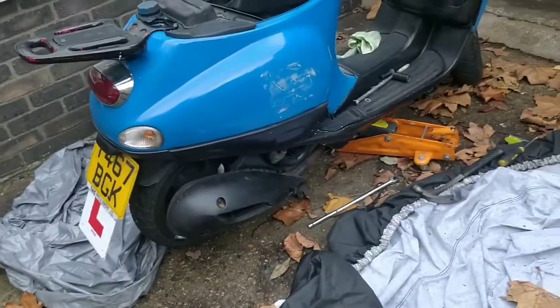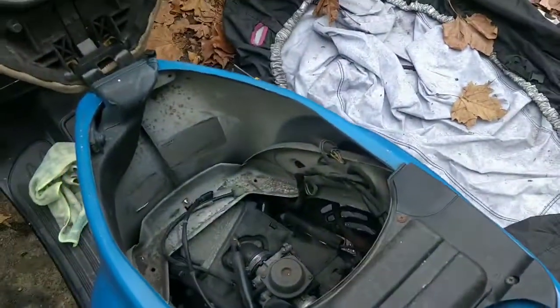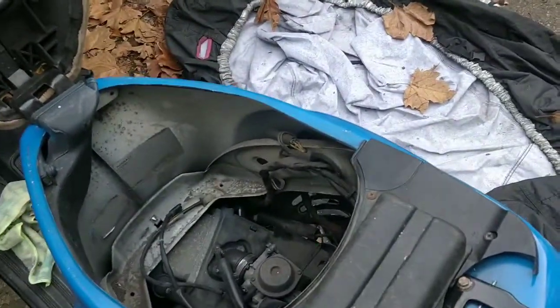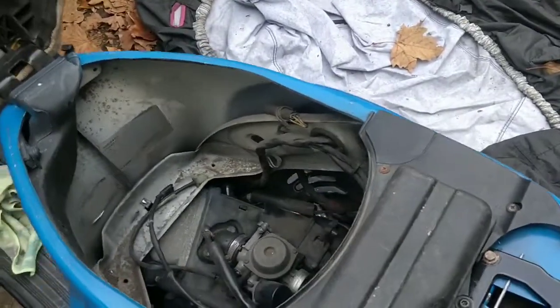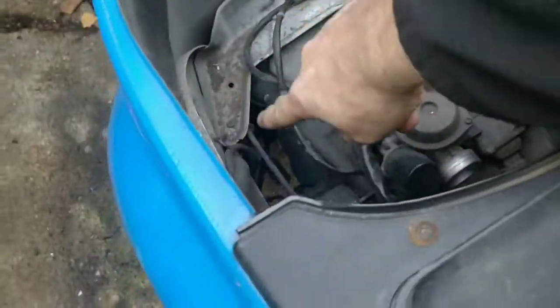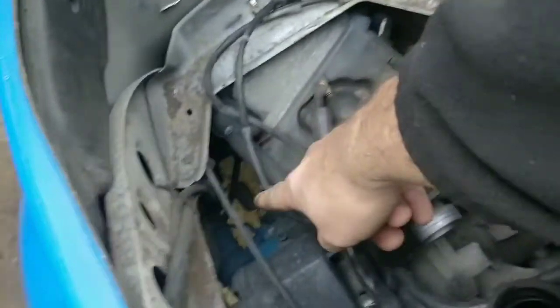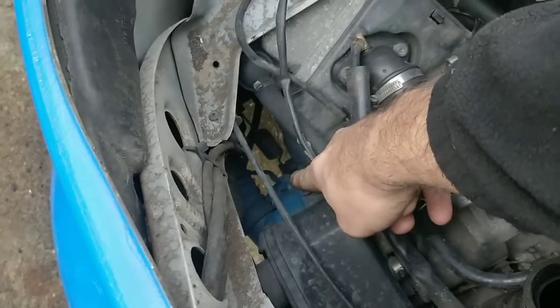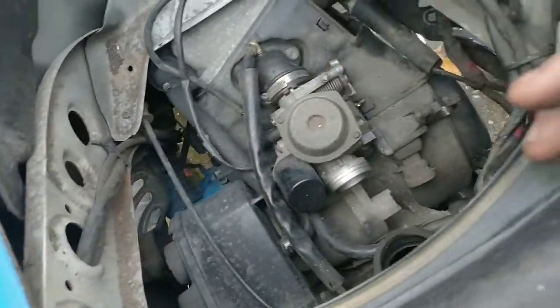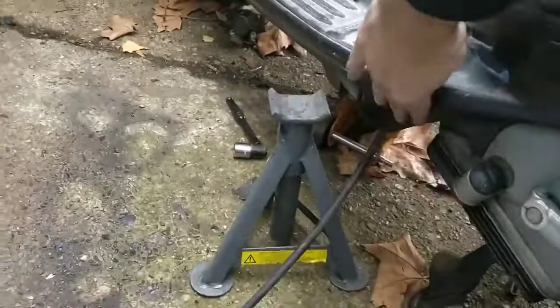Okay, guys. So, rear shock is undone. Now, this is where you play clever, so you lift the rear end and you just see kind of what's left. Like, this is fairly close to being out. Might just need to manhandle it a bit. Now there's a spring there that's going to have to come off, and there is still this wire down here behind the tube that is an earth, but you can't really get to that because it's behind here.